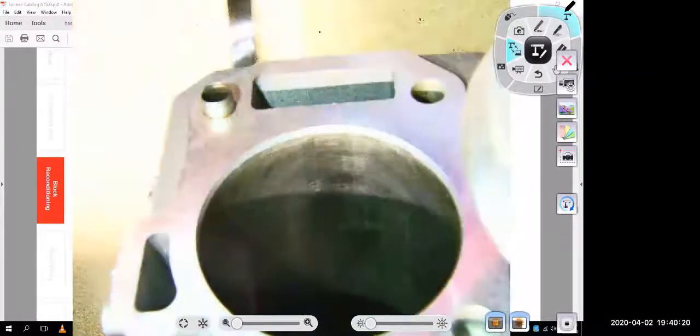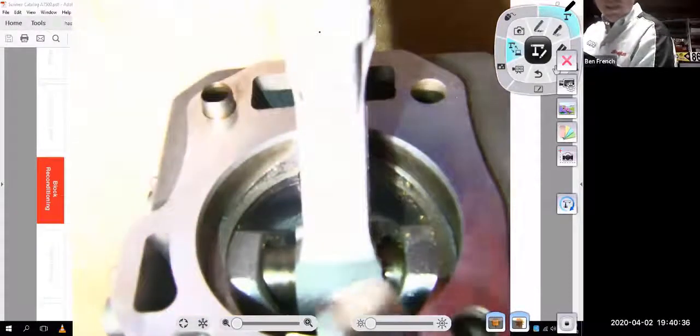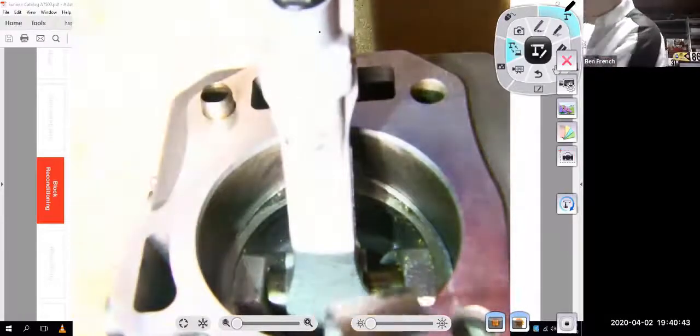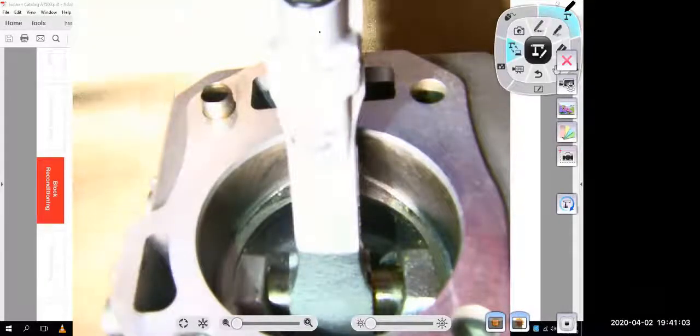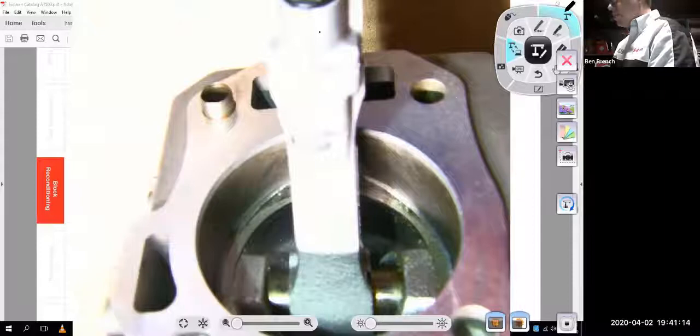It shouldn't just slide out real easy, but it shouldn't feel wedged in either. So all your parts need to be nice and clean. I'd say this engine has about two thousandths of piston-to-cylinder-wall clearance. That old school feeler gauge method works for checking cylinder wall oil clearance when building at home - from modern engine standards it's probably a little antiquated, but it gets the job done. I find many students can be more reliable with the feeler gauge method than with measurements if they're not competent with a micrometer.